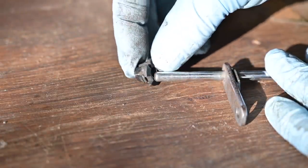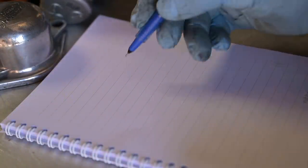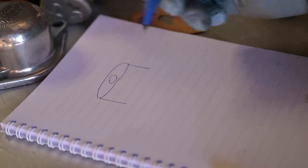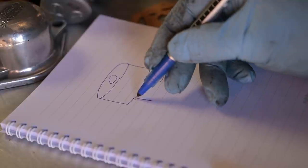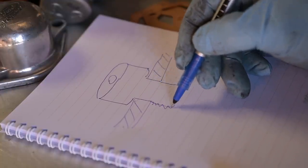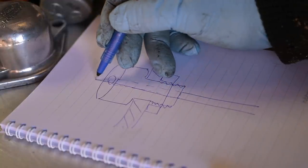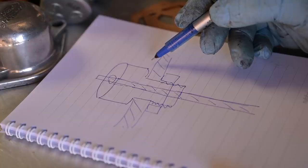This is the actual piece that is holding the linkage onto the frame, and I'm going to change that because it's a little bit flimsy. What I'm going to try to build is a support mechanism which is a little bit bigger than what we have now. I'm going to make something like a big tap with a hole in the middle where the linkage will come through, going down like this with the support sitting there. On the outside I'm going to have threading so I can put a big nut on, and that's where the spindle or the linkage mechanism will fit in. I'm going to make this in nylon.